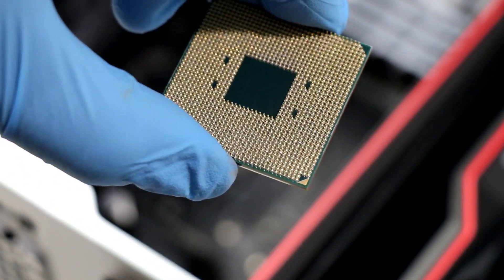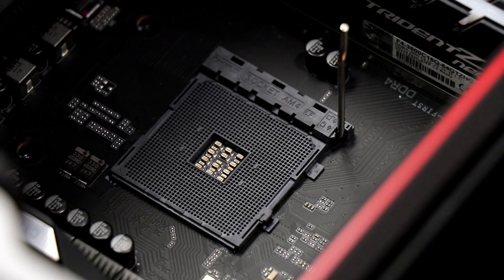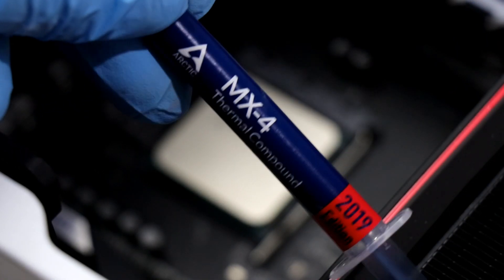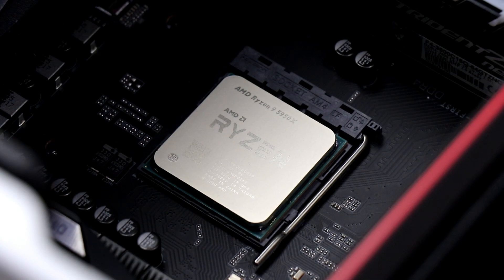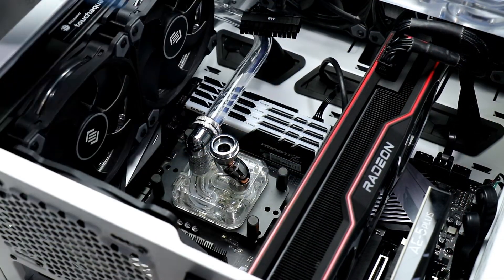First, let's determine the chip's pin one location, labeled by a small copper triangle in the corner of the chip — you can also see the pin configuration is notched differently than the other corners. Here's the pin one location on the motherboard, etched into the socket and printed on the PCB. We just line those up, drop the chip in, and drop the socket latch bar. For thermal paste, I'm partial to Arctic MX4, going with five small dab points as Arctic recommends. Now we crank the cooling block back down in a crisscross tightening pattern, then reconnect the send and return feeds to the cooling block fittings.